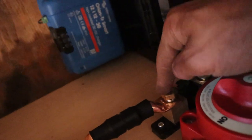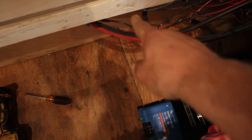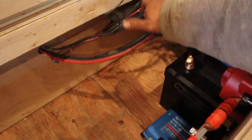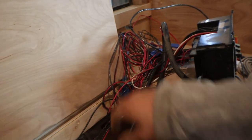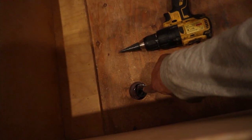We got that in. Now we just got to do our ground wire. Our main ground goes from the non-battery side of the shunt — the load side — over to the middle side of the bus into the frame, and then that's our main ground bar. We've got the solar wires here, already done for a while. This is our 30-amp from the side of the bus. All these DC and AC wires are here, but the main components we want are our 30-amp inlet, our MPPT, our alternator connection, and then our ground wire. Then we're pretty much good to go to start mounting all these components, and then it's just spider web wiring and making it look nice.